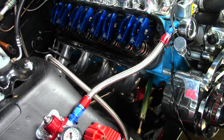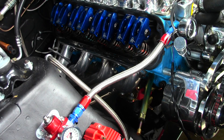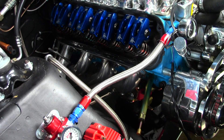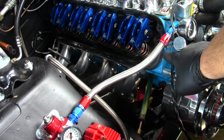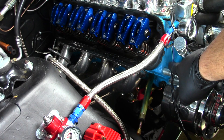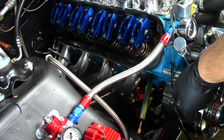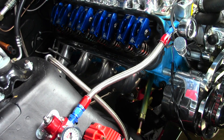So that's what this video is going to be about. I'll probably do this in a few video series, but this is basically going to be locating top dead center. What top dead center essentially is — and if you found my video you probably already know — it's basically when the number one cylinder, which is this one right here, the closest one to the passenger side, when this is at its highest point, that would be top dead center. And it's on the compression stroke, not on the intake stroke, which is where you'll hear like 180 degrees out.